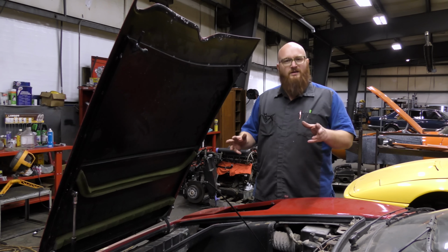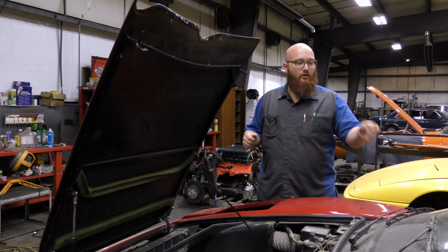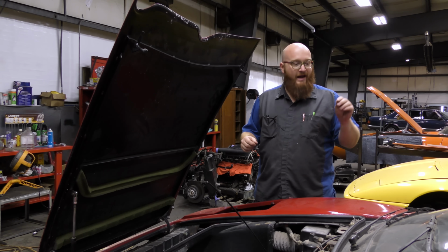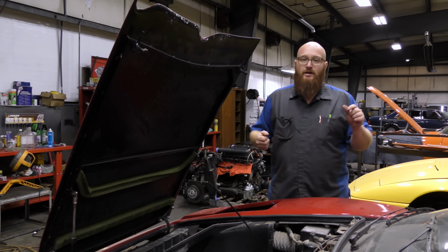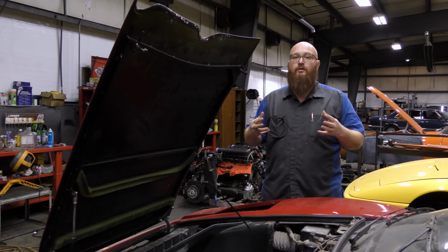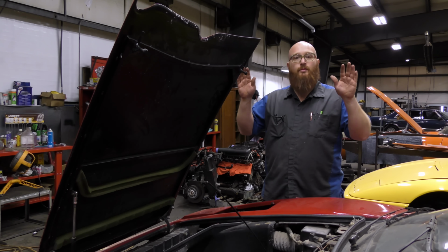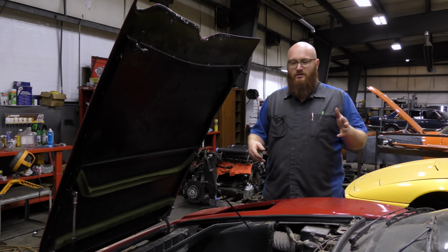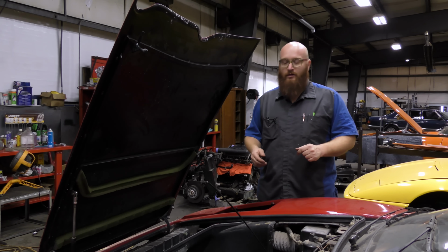The next thing we have up is we got the headlights working. Magic Mike had some issues with what's going on with the relays and everything like that. And it actually ended up being just a relay that was fully melted. We actually had to bypass that little slot on the relay board and ran our own brand new relay. And everything came back alive. The headlights go up, they go back down, they work properly again. A lot of people in the comment section said it was this or that, and it actually meant none of those things. It was just a bad relay.